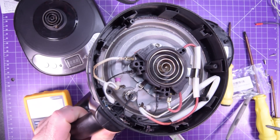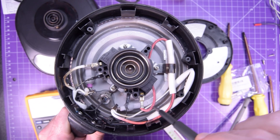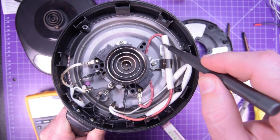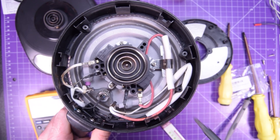Make sure it's unplugged — this one is not plugged in. So knowing that this is the heating element, this wire goes around here to the element, around the element, and then back out to the middle here. And right here, if you can see, clipped on to the element — that is our thermal fuse.